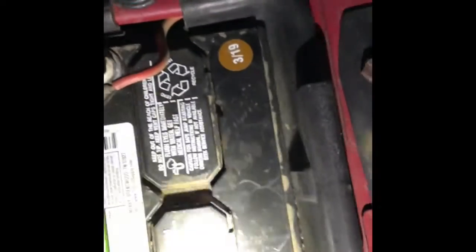The battery — I see this says 319, which means this battery was made in 2019, so it's pretty new. But if you see one marked like 212, that means the battery is almost 8 to 10 years old, so that tells you the battery isn't new and has probably been sitting outside, so it's likely worn out.